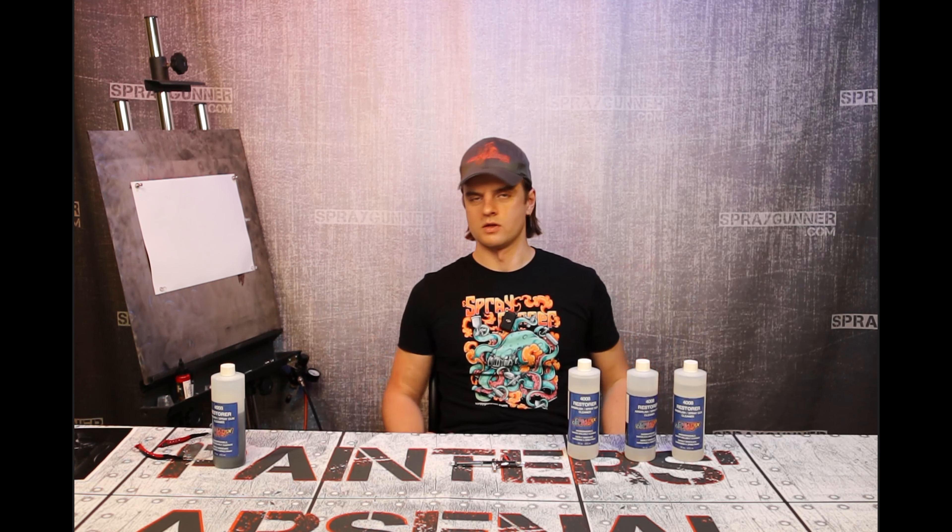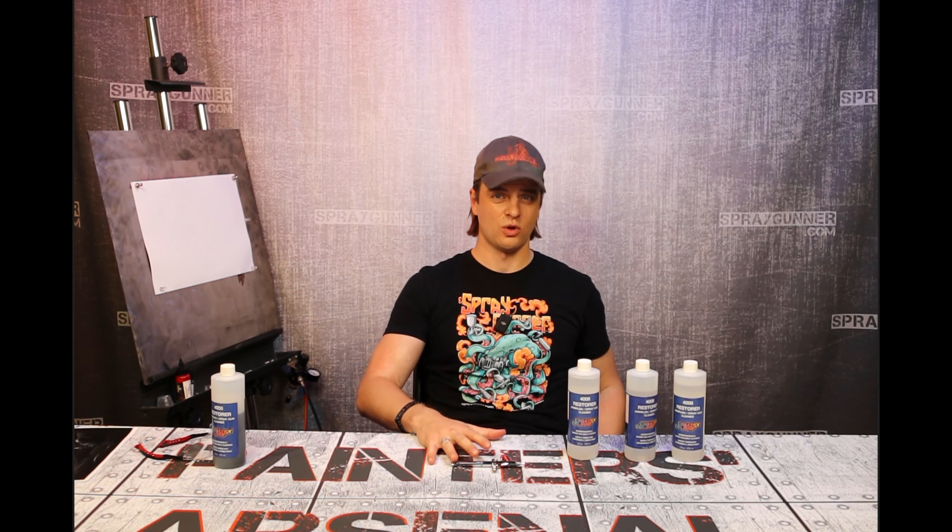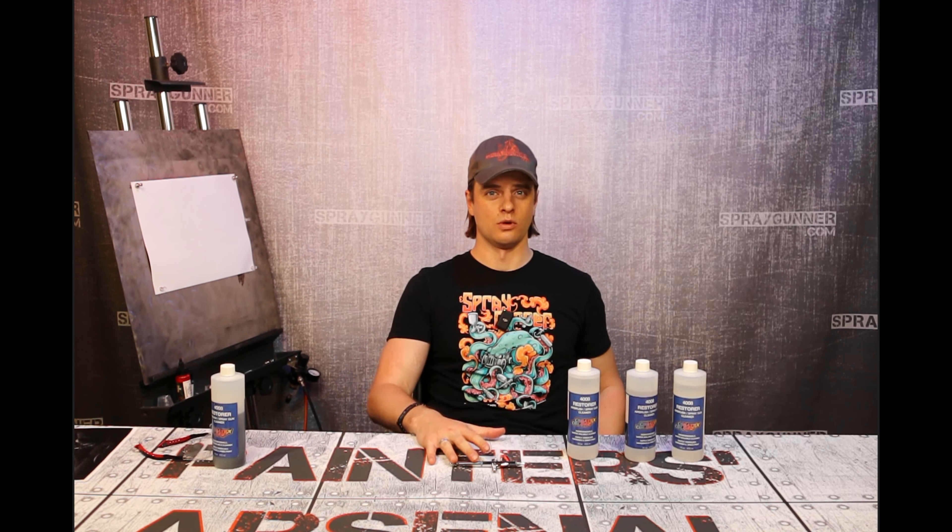For spray guns as well — if you have a dirty spray gun with dry paint in it, I'm not sure which particular solvents it will work with, but I was curious in my case and it worked on a 2K primer. So pretty sure depending on the paint you have, it might help with your solvents as well. Just do a test panel, as I always say. Anyways, I hope it was helpful. That's it for today. Thanks for tuning in and see you in the next one. Bye!